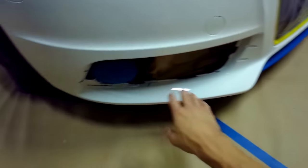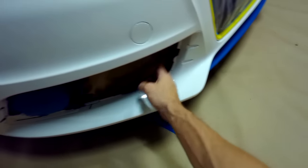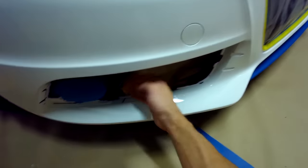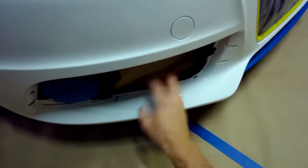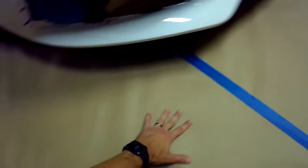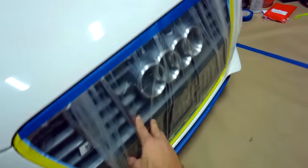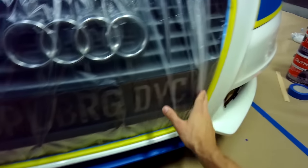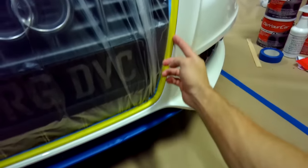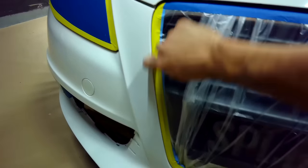Down here at the fog area, we masked off the fog lens itself with blue masking tape, then covered the large surface area by pushing in brown masking paper underneath, to the side and above this entire gap, so any overspray that goes through gets caught. The brown masking paper comes in handy quite a bit — we cover our entire floor with it. For the front grill, we covered the entire surface area with tape and drape, sealed it down underneath the hood with blue tape, and then used yellow masking tape all the way around the edges to make sure our edges are nice and tight with sharp lines.